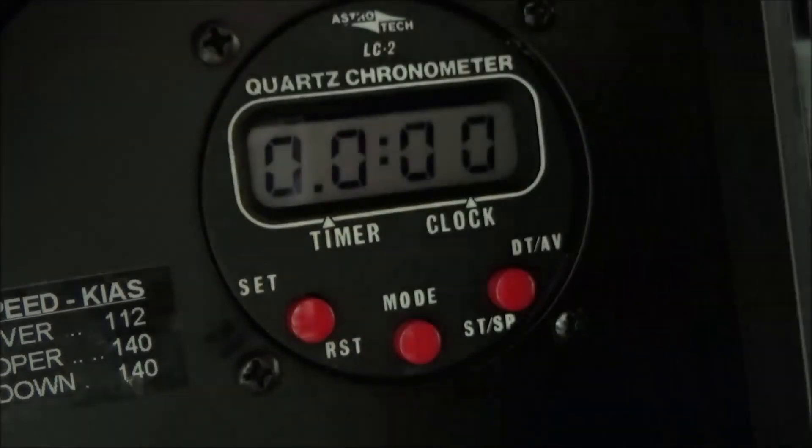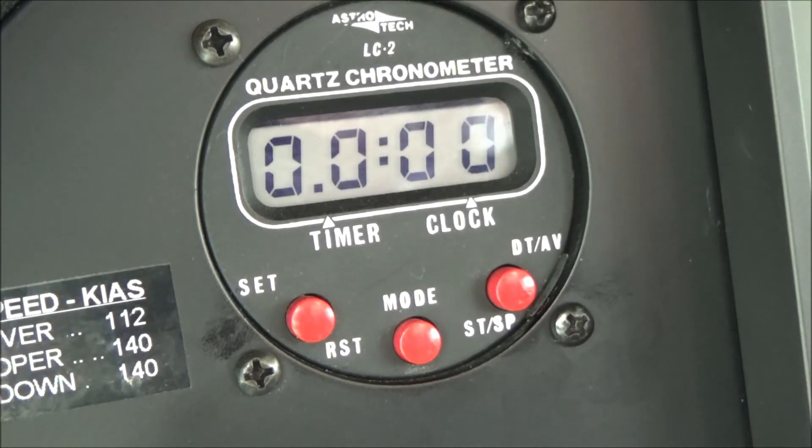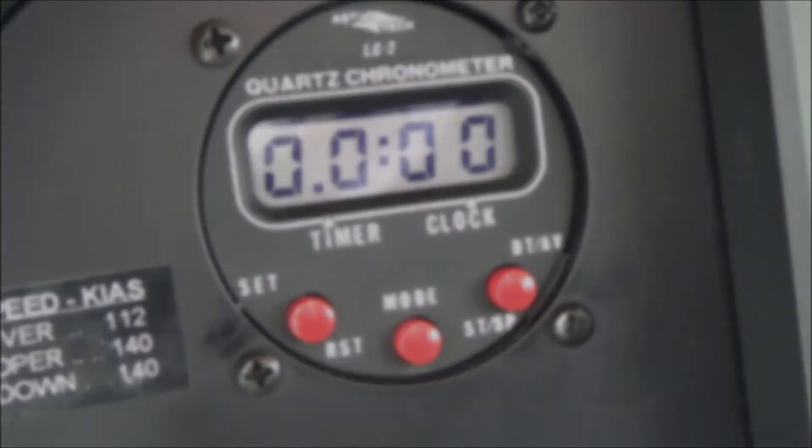Now you know how to make it work whether you have one in a Cessna, a Piper Cherokee, or whatever airplane. These timers are handy to have as a backup. A new battery will last between two and five years - buy a high-end battery, check for corrosion on the leads, and note the polarity: the black wire goes to negative and the red wire to positive. Thanks for joining me - thanks for flying with Frank.